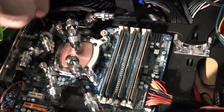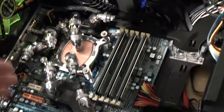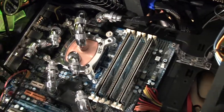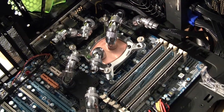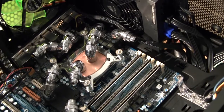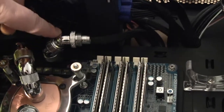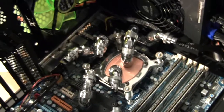Let's have a look at the CPU area. My original objective was to make a sequential loop going from MOSFET to MOSFET to CPU to chipset, and from chipset to the graphics card. The reason I wanted to do that is because when you drain a cross-connected system, it's difficult to drain and you get liquid trapped in blocks, which creates additional problems — I had to deal with spillage while working on the computer. Unfortunately the spacing was still too short and even with all the connectors I wasn't able to achieve a fully sequential connection. But I did still improve the linkage quite a bit, because I added 45-degree adapters to each 45-degree compression fitting, giving me a nice 90-degree turn. So instead of routed tubing, I have direct tube runs which are shorter, leaner, perform better, and will look much better than before.